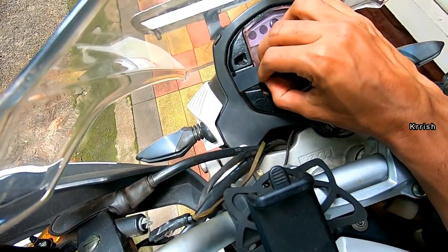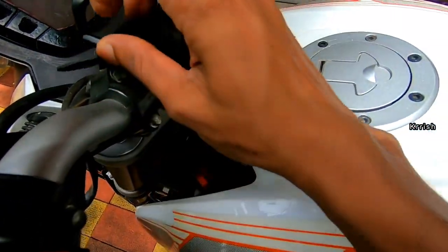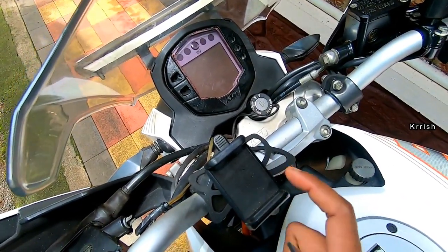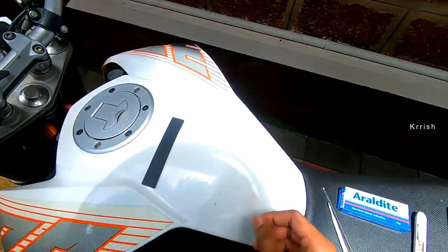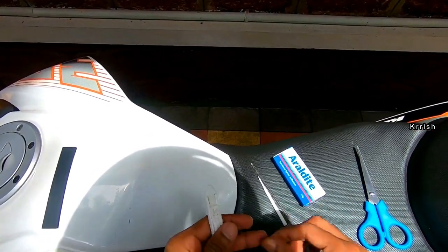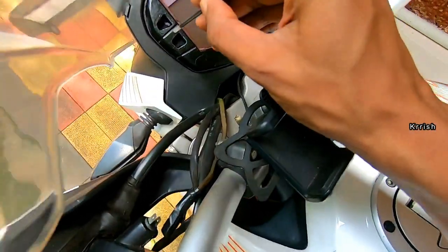If you don't have a piece like that, you can use tire tube — just cut a piece of rubber from the tire tube to match the size and shape of the hole. You can easily source tire tube from a tire repairing or puncture shop. Next we require a gum to stick the rubber piece; I'm using Araldite. To cut the empty refill and rubber piece, we will require a knife or scissors. There is a small hole inside the meter console.